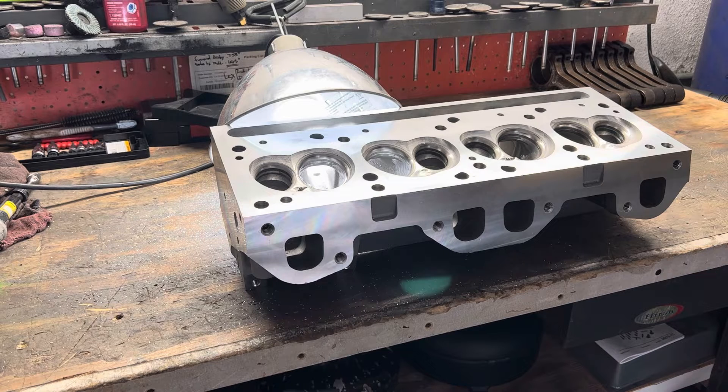On this cylinder head, it's mostly the two inner cylinders. The intake ports are slightly offset — imagine if you had a doorway and someone built a hall that came down and didn't line up with the door. Basically, the intake port as cast isn't lining up with the hole of the valve seat. I can't modify or don't want to make that seat opening bigger to compensate for the port offset, because that's the wrong way to go.